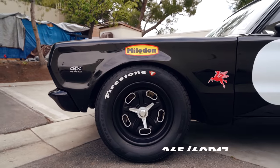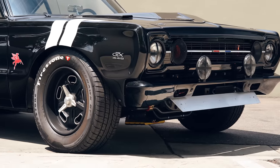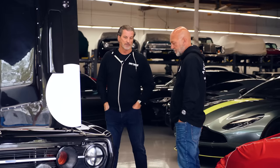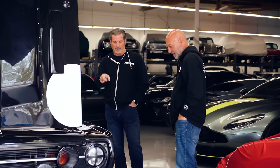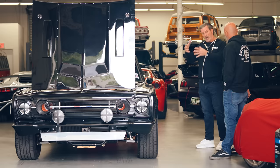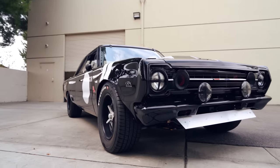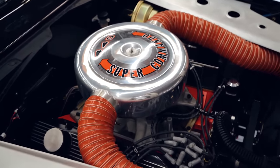The size is 265/60/17 all the way around. Same size but changing the stagger of the rim on the same tire creates a taller crown for turning on the front and a flatter surface for traction on the rear. It gives you a universal tire size so you're not chasing discontinued sizes. These are real knockoffs — you can see the safety wire. Inside there's a wheel adapter that Vintage Wheels makes on a Wilwood hub, with a six-piston caliper — it gives you the real knockoff performance in that kidney-bean Wilwood style. It's a powered brake setup with a brake bias adjuster.